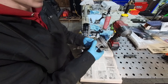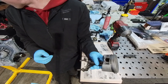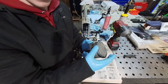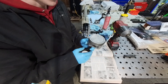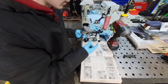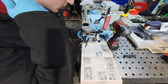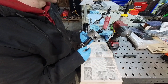I'm already at the piston installation. When you're doing this, it's really important to make sure that the piston ring gaps are in the right orientation in reference to the front locator pin of the piston. Any manual will tell you that — either the OEM Nissan FSM or the Haynes manual explains and shows that. So you just make sure the rings are in that right spot.